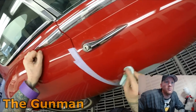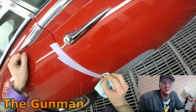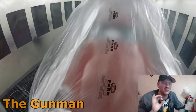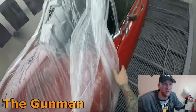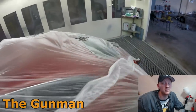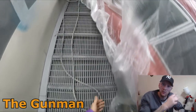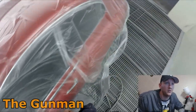I'm just wiping a bit of prep sol over the blend area prior to doing my masking to make sure it's all clean. A lot of the time I don't do that, but on a spot repair it's probably a good idea to prep sol before you do your masking. As you probably noticed, there were a few little bits of red paint from when I was checking my color card — sometimes there's a little bit of red from the back of your color card — so I obviously had to make sure I cleaned that off.